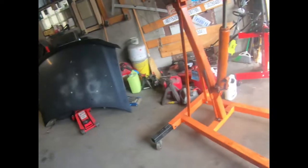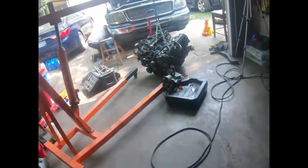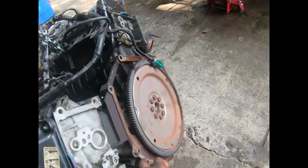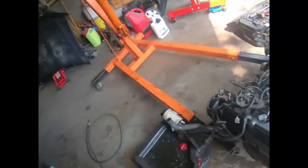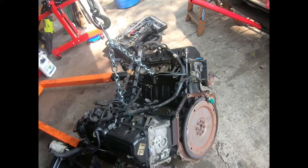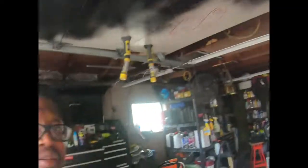Might find some fruits to help. So, on this one, they pulled out the dowel pins. So we got to swap over the dowel pins for the transmission. So we got to pop these ones out of this one, with the alignment pins. Pop these out of that one and put it over in those. You get the torque converter bolts lined up. This is a lot.